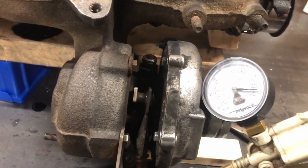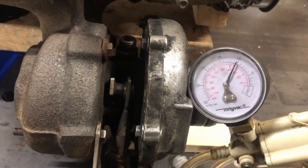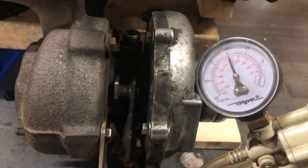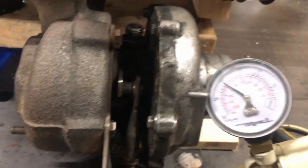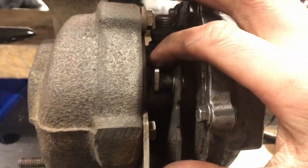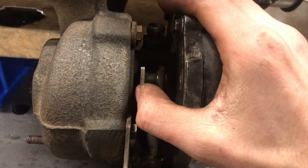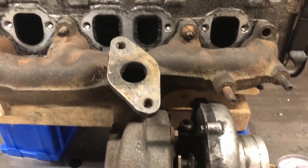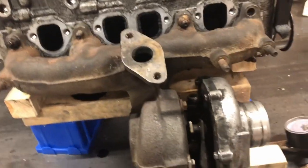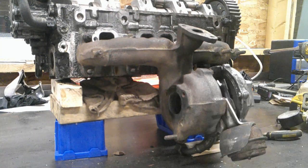Let's take a baseline — it should hit the stop at about 18. It's actually not too far off, but it doesn't go all the way up. That's usually how it'll go: you have enough vacuum to pull it down but not enough spring tension to bring it back up. So we'll fill the port full, work it free, and see if that's any better.